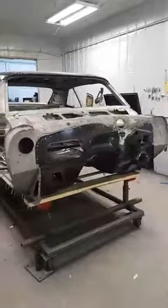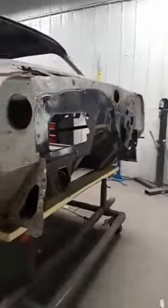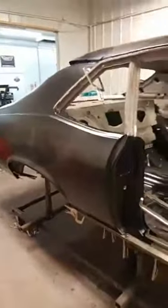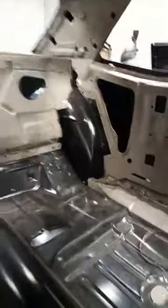All of the black panels that you see on this car right now are replacement sheet panels. Some of them are screwed into place, such as the firewall. Some of them are welded — we had to do a minor repair up underneath the dash, so those are actually done and welded — and then we've got some that are clamped. We're running out of clamps, so we're going to have to go ahead and screw some of those in so that we can continue clamping the quarters on the car. Steve has got the floor in place. The trunk floor is also in place — you can kind of see through the back of the car there. He's got the inner quarter wheelhouse replaced on that side; this one was okay so we left it. Both of the outer wheel housings are also done, which you can't really see because now the quarters are set on it, but it's the black thing you see through this quarter opening.